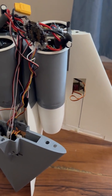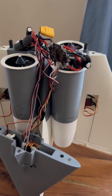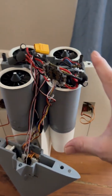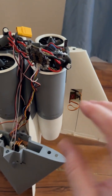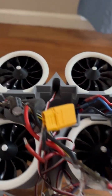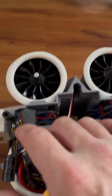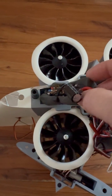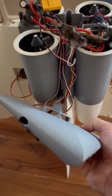I'm running a 6000 milliamp 100C battery and I'm drawing around 264 amps. Depending on the battery — this is why I keep saying I need to get a good battery, a new battery technology — something to make this work the way it was intended. Foam isn't helping that much for keeping everything cool, but I kind of had to group these wires up. That's why I put the holes in the front to let air go through.